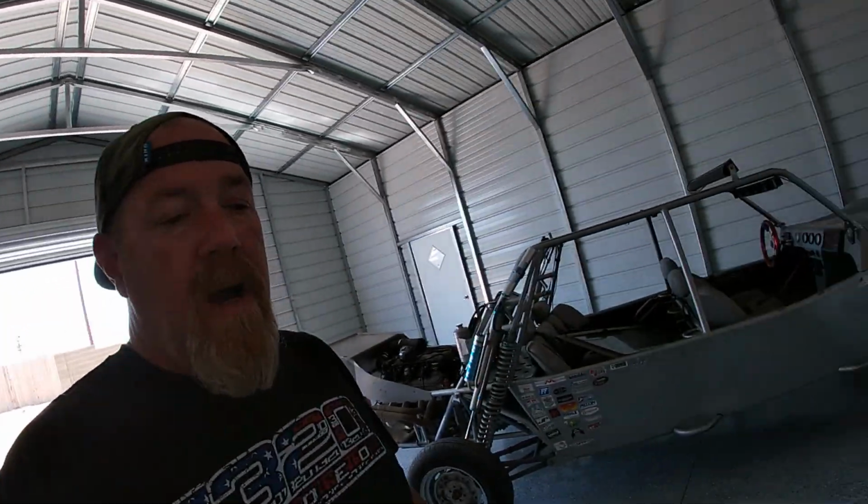So we tried to take the Civic to the track last night, and turns out that the event is not until tonight. So that's going to give us a little bit of time to do some work. As you guys may remember, I'm double slipped. I'm slipping through the viscous coupler and slipping through the clutch packs in the CRV rear diff.